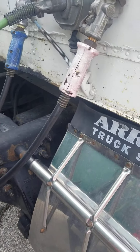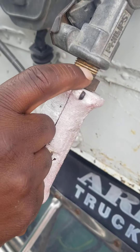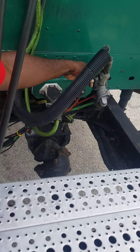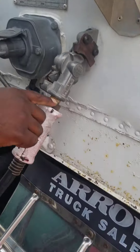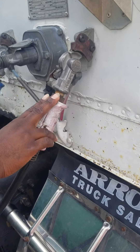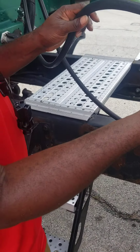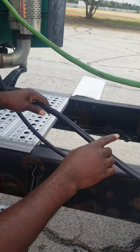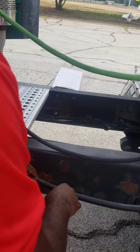Now, the connection points — secure points from the truck to the trailer. Not missing nuts, bolts, or screws, not being broke or cracked. It's not leaking. It's properly mounted and secure. The line has no abrasions, bulges, or cuts, not cut, frayed, or torn, not tangled or spliced. It's properly mounted and secure.